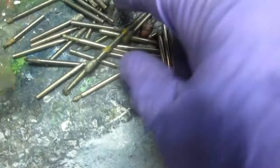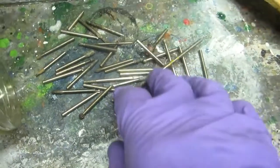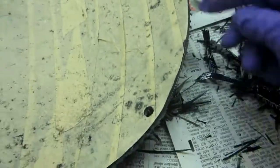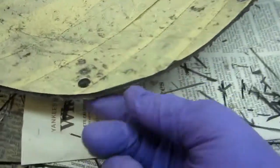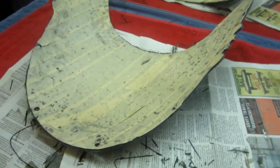We have buckets of cutters here for doing different jobs. There's one cutter called a Roto-Zip — it's made for a special machine called a Roto-Zip, but we can use it in a Dremel tool. You want to be really ultra careful using this. What it does is it can rough-trim the edge and get rid of a lot of these extra little edges. You can also rough cut where the holes would be. Now we've got to just finish this edge — the rest of that finishing of the edge we'll do by hand.